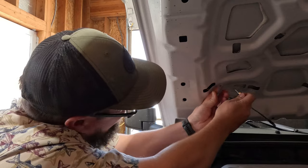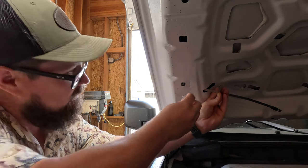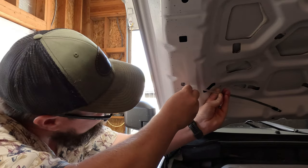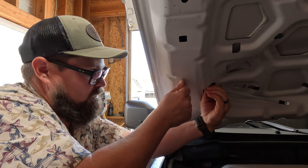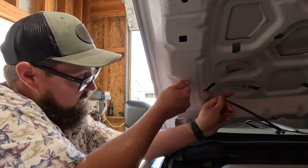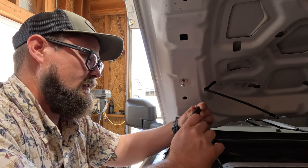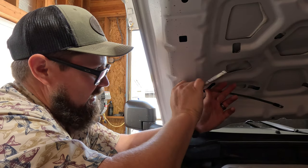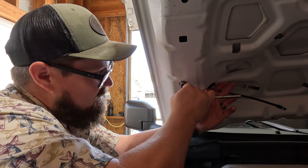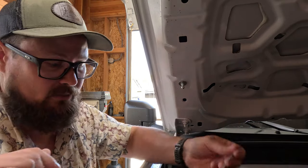This is probably the hardest part. Don't forget your other washer. You see, I was already trying to mess up the simplest instructions, but there you go. You just got to get it started. You got to put a little pressure on it. I kind of twisted this one and then we're just going to tighten this into place. I'm just going to take this here — this is a 12 millimeter deep socket — and tighten this down. It doesn't have to be too tight. You're just pinching this into place. Once you get that, you can pull this out, and you're going to save this other one because this is for the other side of the hood.